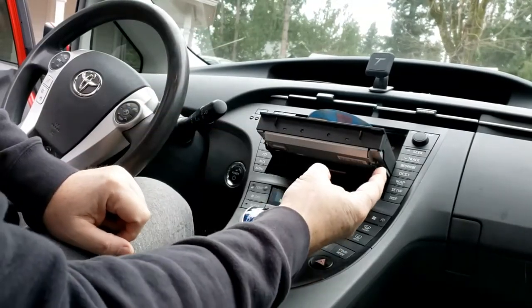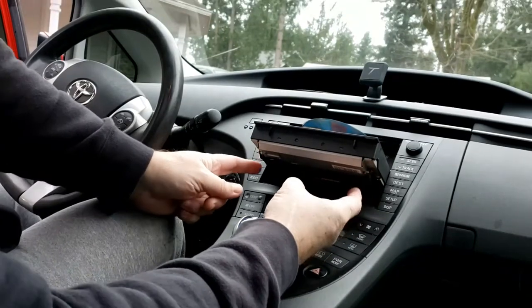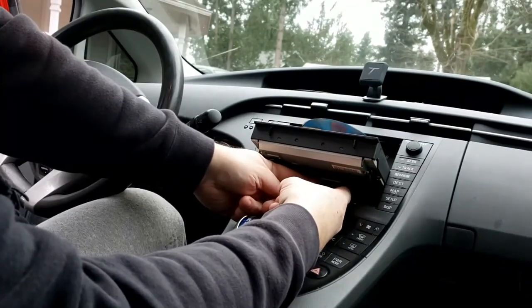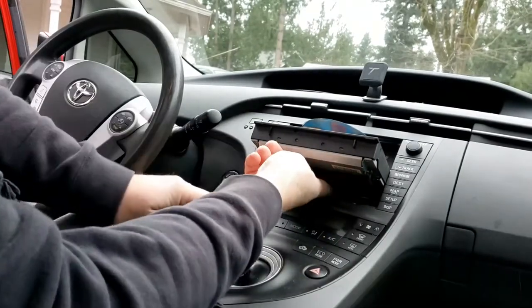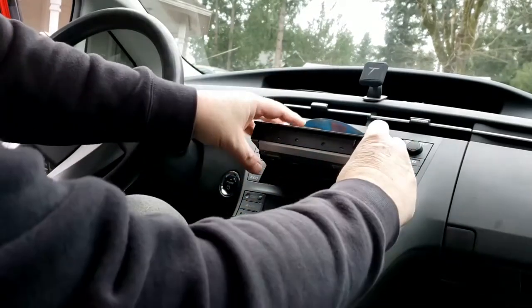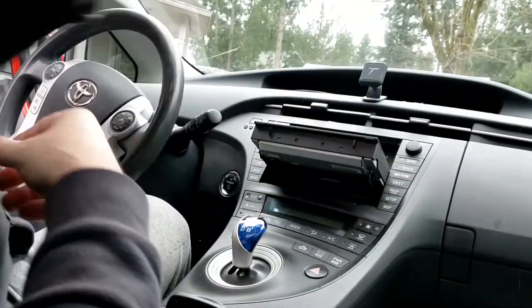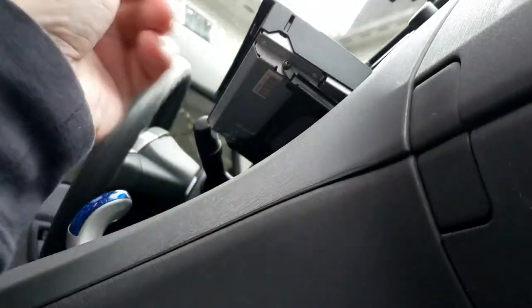Quickly, it's actually going to be removing these two screws, which are just a Phillips. There's going to be a small little tab-driven kind of connector. It's a ribbon connector down here that we will pull out. And then this just comes all out. So I'll show you how that works. Okay, we're looking at the side of it here. There's our Phillips we need to take off.